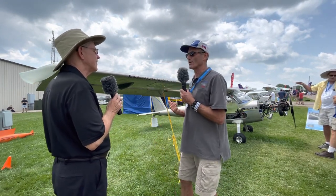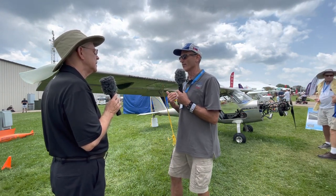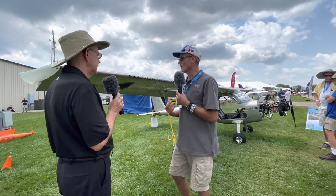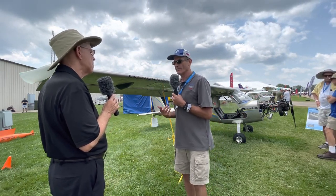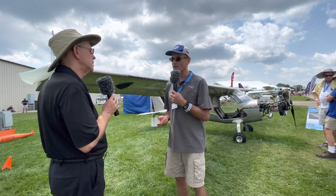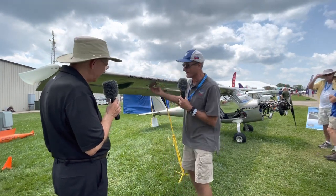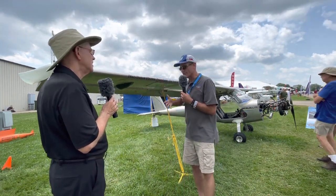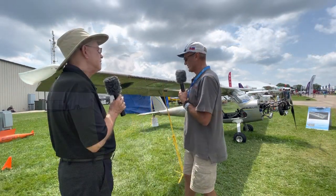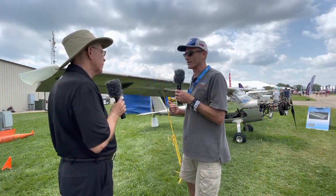It's very difficult to fly an electric airplane with any endurance or speed because all your payload is sucked up in the batteries. So we have about eight pounds of battery per wing — basically nothing. It's four little RC packs that you can take out. They're mounted on a little hatch with cam locks that just hinges down. And they just charge the batteries in flight off the alternator. It's a great candidate for electric.